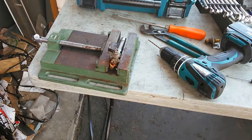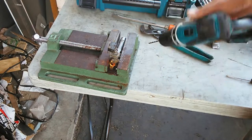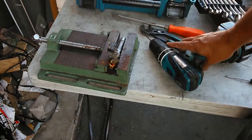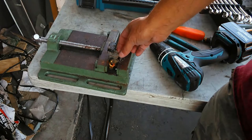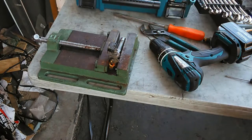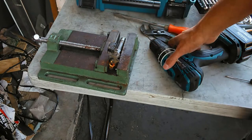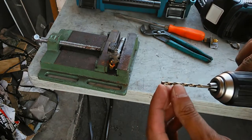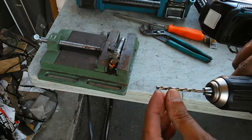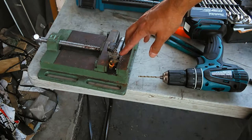So now I've drilled through — I've got the head of the screw off. I didn't want to drill too far because I was afraid of digging deeper into the housing, and I really don't want to do that because it's a pressure point. I got most of the head of the screw off. Remember, a drill has a taper to it, so the middle part's deeper and the ends are not quite as deep, so I don't think I really dug into that.